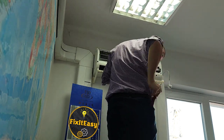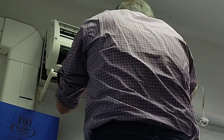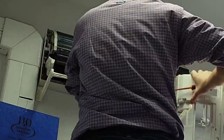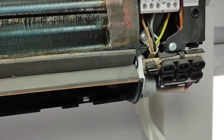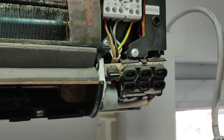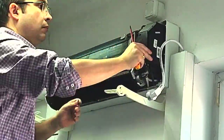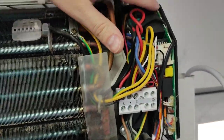You can see here I am unscrewing all the screws. Now, when I have removed all screws, I will remove the front panel and reach the main board of the unit. This is how it looks inside the unit — here we are going to look for the capacitor which is responsible for the turbine fan. When we reached so far, here is the main board. I will pull the board a little — this will let me reach the legs of the capacitor.